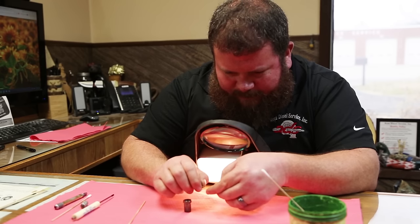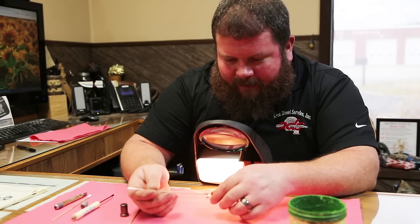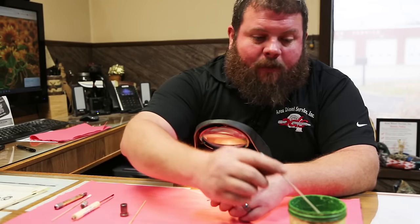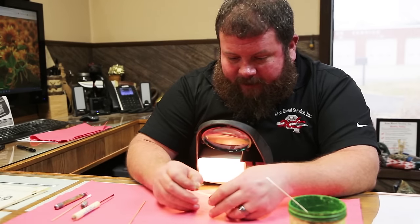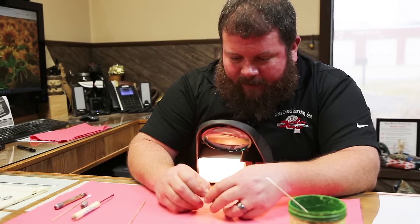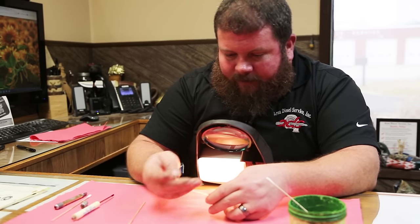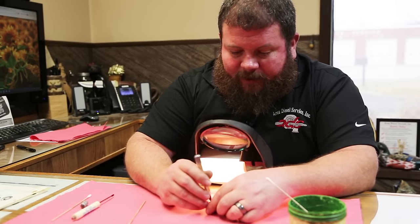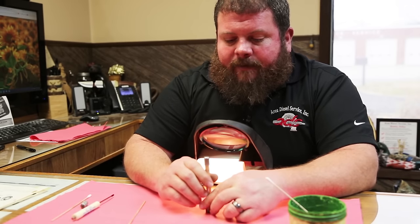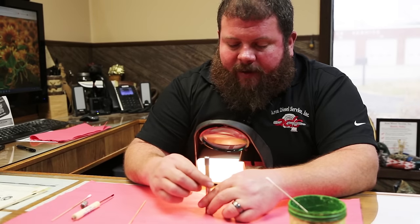On more modern injectors, there is a new assembled specification, right? It might be 1500 PSI is the opening pressure specification, and that's what you should hit on a freshly remanufactured or brand new assembled injector. But on a lot of the newer stuff, there's also a service specification. So if it's been in the field for 1,000 hours, it's not still new. It may not still be at the factory specification. Doesn't mean it's bad. We get into that a lot with common rail injectors, right?